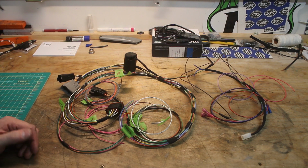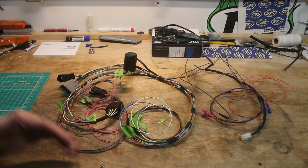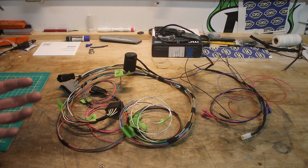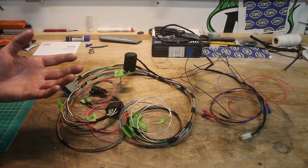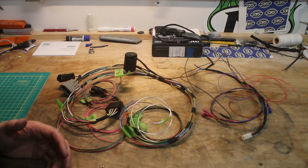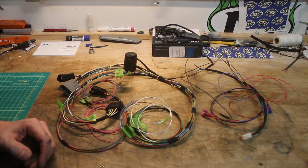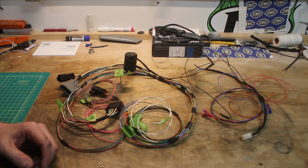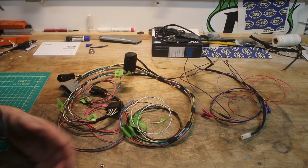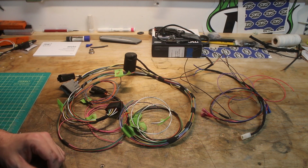One of the things about these pre-CAN bus bikes, and particularly the ones without an ECU or much onboard electronics, is every wire just has a function, controlling one thing or another, and it's all very straightforward and easy to understand, as opposed to computer wiring and CAN bus and things like that, where it doesn't make any logical sense. You just have to know which wires go where.